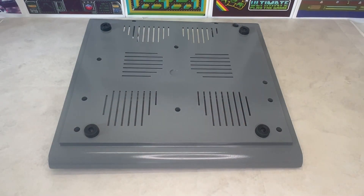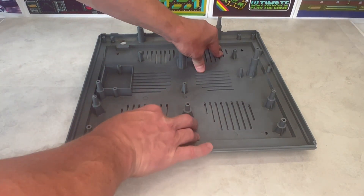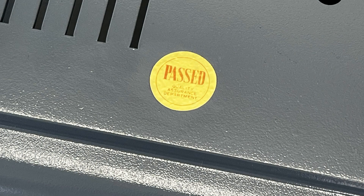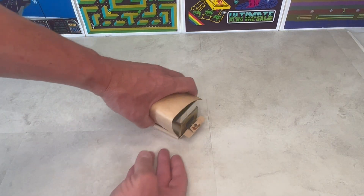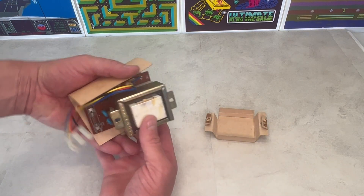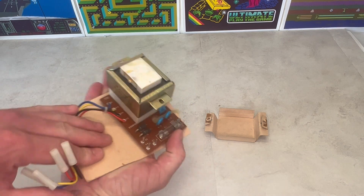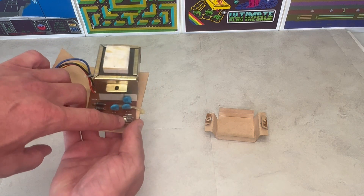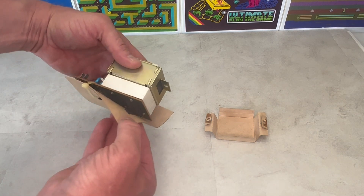Putting the feet back on to the base of the unit and making sure the base is stable, it's time to put the model and QC/PAS labels back on the base of the computer. Having checked the power supply unit over for any capacitor breakage, leakage, splits or otherwise — to be honest, there's not much that could go wrong and it actually looks pretty good — so I'm happy to leave that where it is, thin cardboard covering and all.